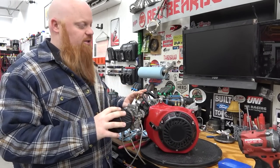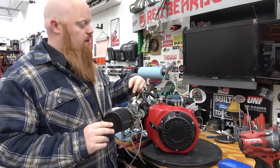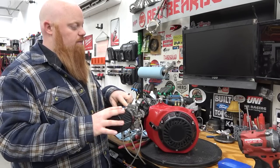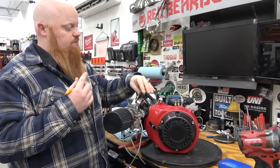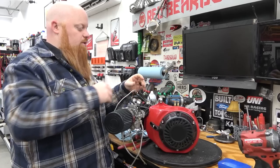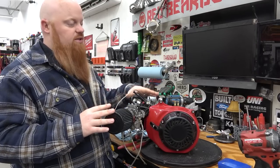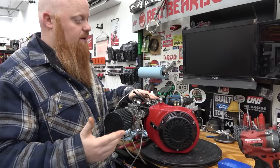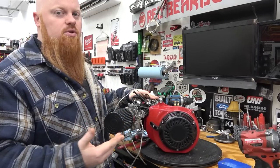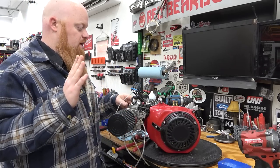So we got everything freshened up on the engine. The only thing I have to do is go get some more of the 3/8 clear vent tubes so I can vent the block properly. We're going to throw this on the dyno, get those hoses hooked up, and we have our temperature sensor — this goes in between the spark plug and gives us a reading of head temperature for the dyno. We normally run our dyno around 190 degrees. Once the engine gets around 190, some stock engines take forever to get up there, but these built engines — you do a couple hard pulls and you'll get the temperature up. Then we take our numbers.